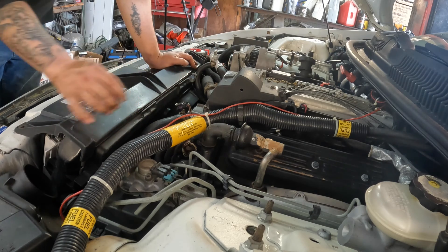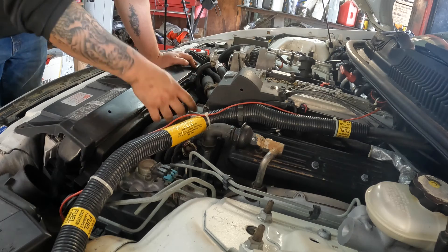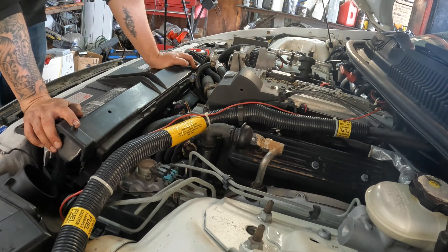Like I said, you will have to take the air assembly out on this. To do that it's just two hose clamps - one on the breather box, one on the throttle body - and then you get like two connectors. There will be a resonator tube that goes down in front of the radiator; you just pull it up and it should clear.